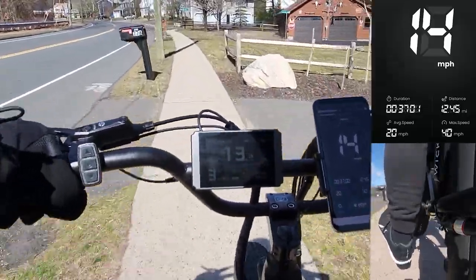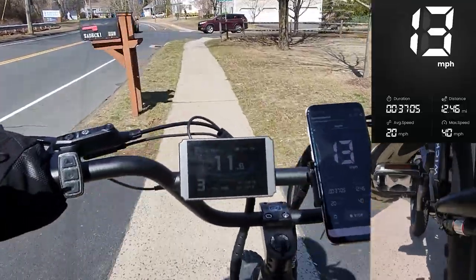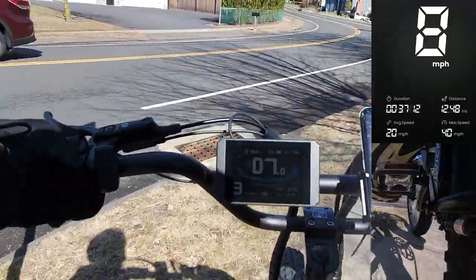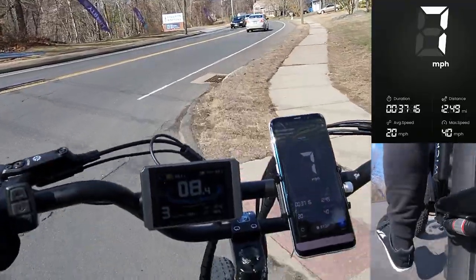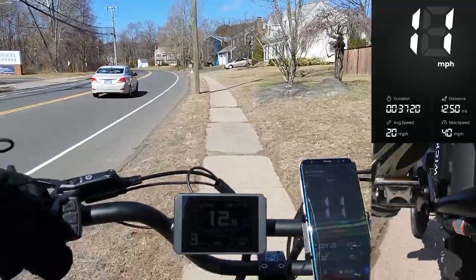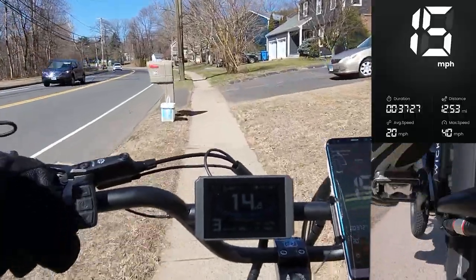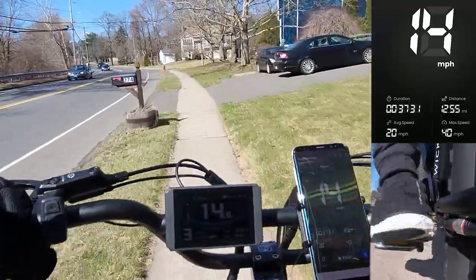And so what that big front gear does, along with the 11 to 34 freewheel, is gonna give you more use from your gears. Because these bikes, they go so fast, and you end up just using the top half of the gears only. And you might as well not even have the lower gears unless you run out of battery or you're on like 10% battery, 15%, and the bike is giving you no power.